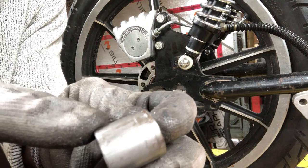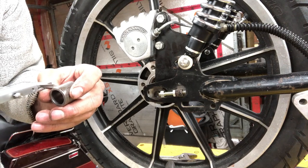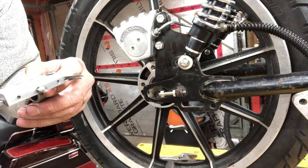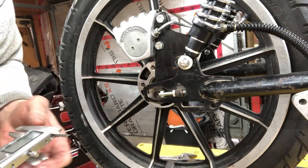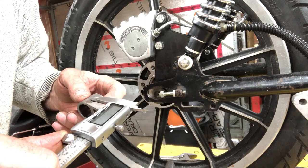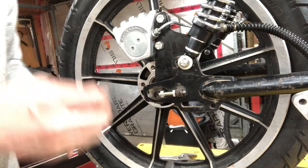So the difference between those two lines right there, a couple mil, 3 mil, 1/8 of an inch. How much longer I need to make this one. Two. A little more than 2 mil. Oh, that's 0.2 of an inch. Okay, yeah, I need, let's change that to mil. It's easier to read. Zero it. A little more than 5 mil longer. So I'm going to make another one.